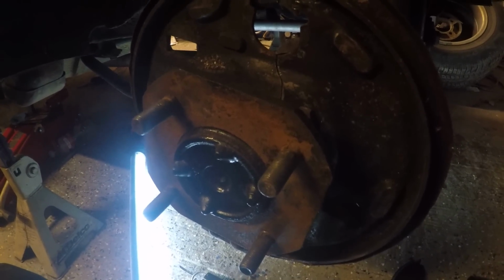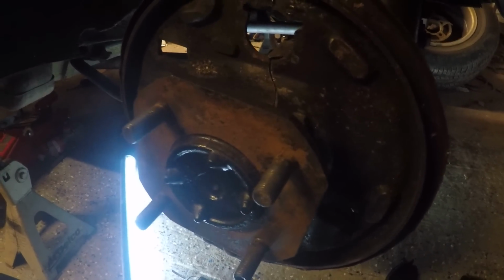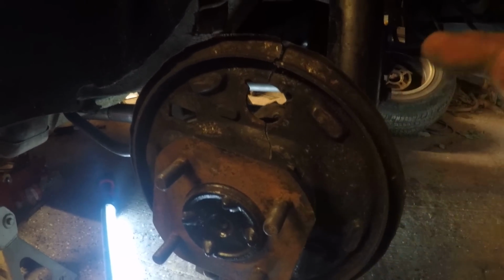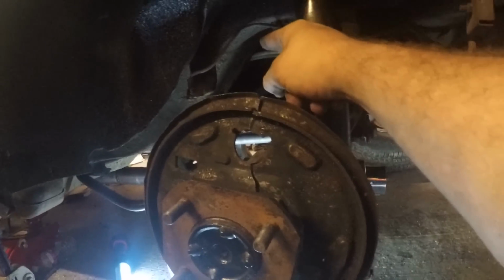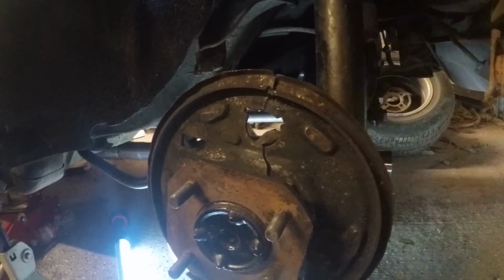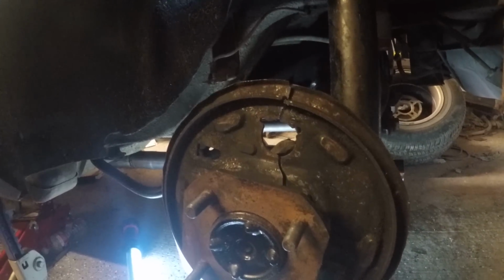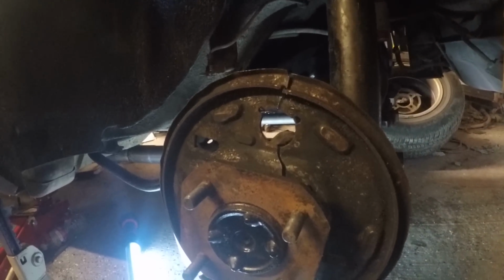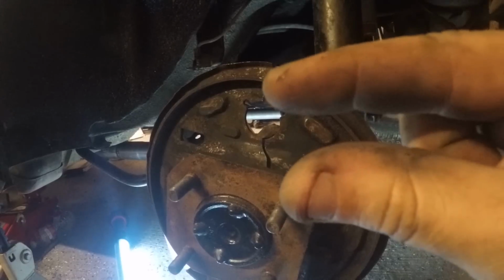The only thing that's complicated is the Ebrake, which with the Ebrake I've heard you can flip it, and where it connects up top there to the main cable. I plan on just loosening mine up, because it only takes just a little bit, maybe this much more to get it to bolt in. It's right there. Or you can make a spacer to take up that gap.